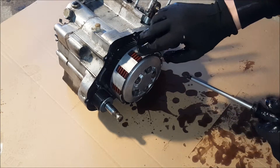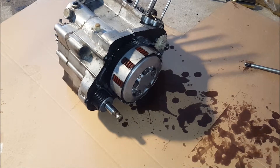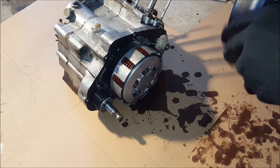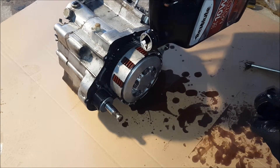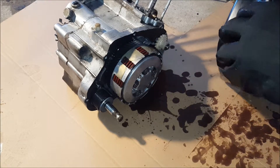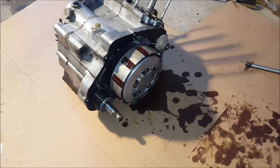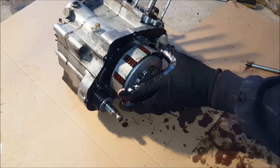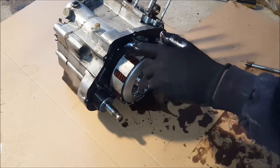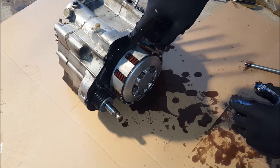The last thing I like to do — since you've got the motor out — is pour a little bit of 10W30 on the whole clutch just to make sure it's oiled. It's really important to have the clutch oiled; otherwise your bike won't work and you'll have to take apart the engine again, buy new gaskets, and go through that whole process. Make sure it's in neutral and you can spin it around.